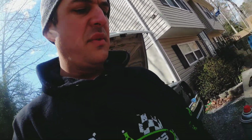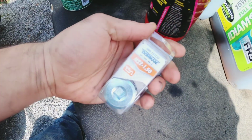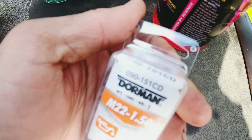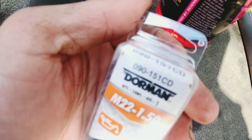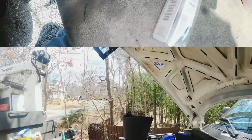So, right, guys, once you have changed the oil filter, go back and get your drain plug. And again, 44 foot-pounds. If you're looking for a replacement, you can get the Dorman ones pretty much at AutoZone, Advance Auto Parts, online. There's your part number. So go ahead and torque it to 44, and time to fill it up.